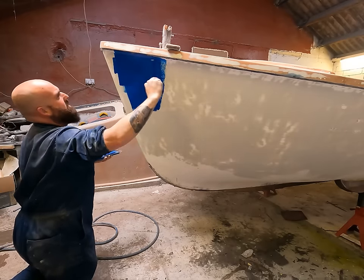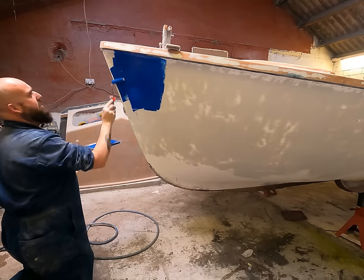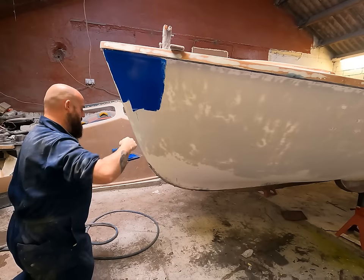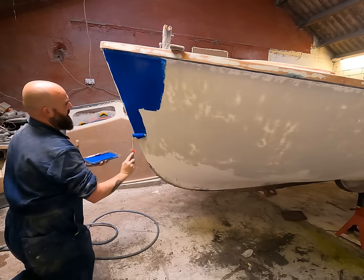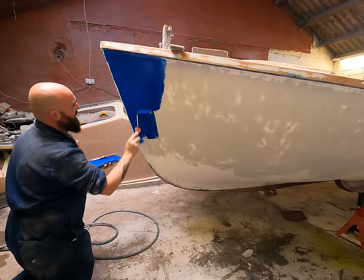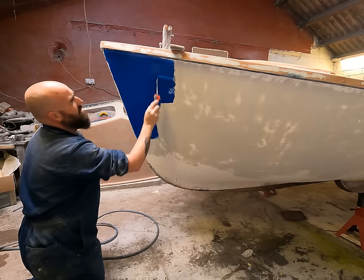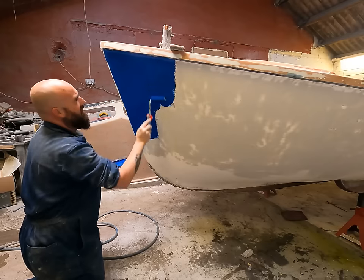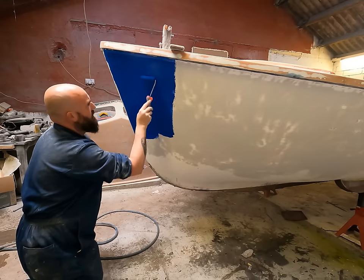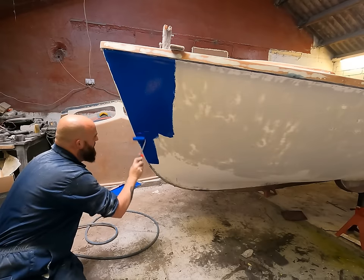You want to get a good even coat — about the thickness of matchbox cardboard is what you're going for. I'm tossing it on with a roller first; once I've got the thickness I want, I'll flatten it in with a brush. We don't want to roll it out too much — try to get good even coverage from the get-go. Once the roller's loaded with material you can see it's going on better. I'll probably do two or three coats in all, and then when I'm finished I can sand and polish the very last one to get that super glossy look.